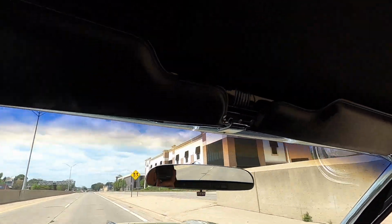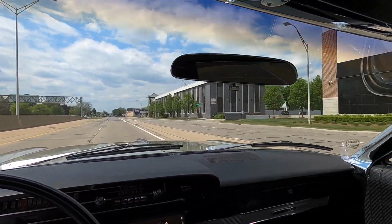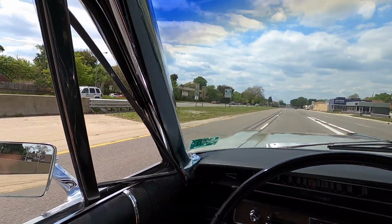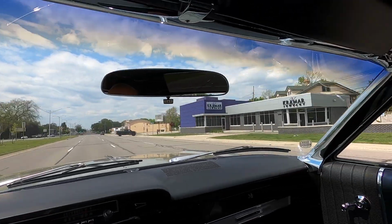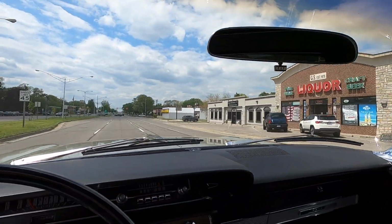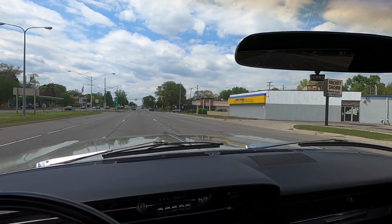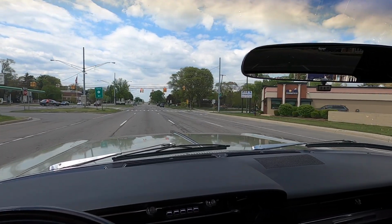I got rid of the wind noise over there, no doubt about that, but I can hear the wind over the convertible top, which I think is pretty normal. I still have that wing window open, but that actually makes it worse because then air can sneak in the cracks. But you can hear those things jiggling. I ordered new grommets for them. But yeah, that took care of, I'd say, 90% of the noise. I think what's left is pretty normal for a convertible.